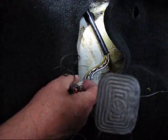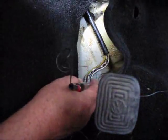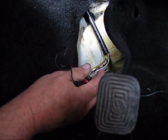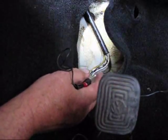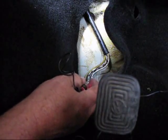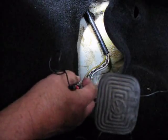I'll put a little WD-40 on that — WD-40 is good at chasing water out of connections — and I'll wiggle those around. The dim light should be on a yellow wire, the bright lights should be on a white wire. If this thing is color coded correctly, I should be able to go to my headlight buckets and identify which is which by the yellow and white wire.